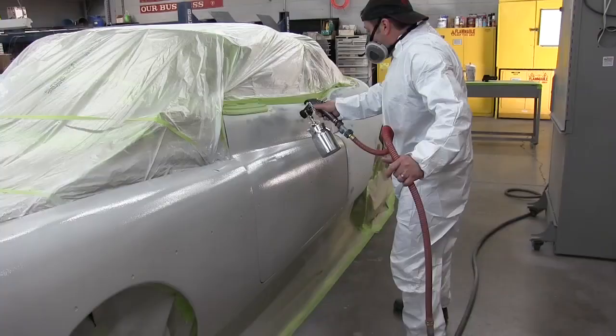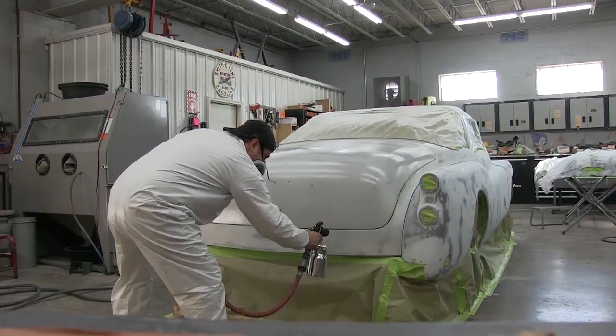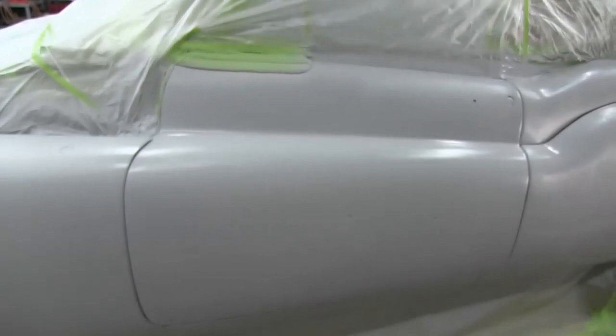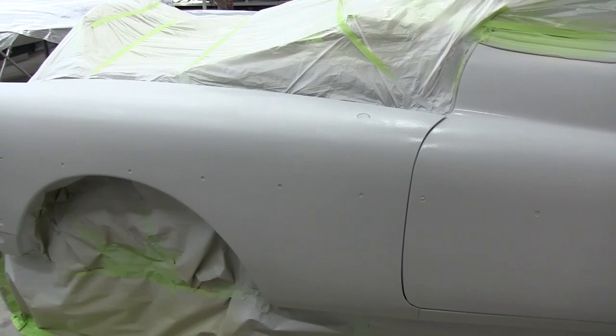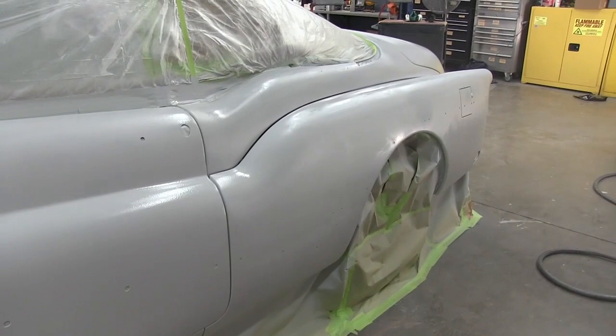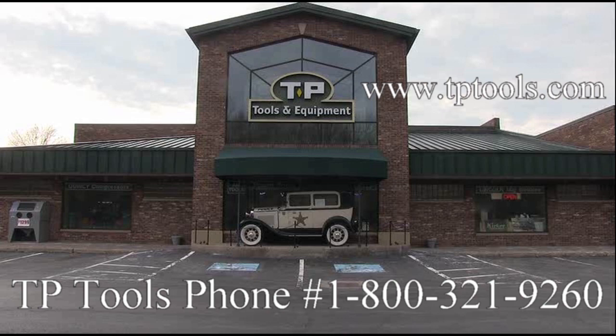Today we learned how to paint our vehicle using a polyester primer. In our third and final part, we'll show you how to finish the job. Our next video, we will use a urethane filling primer, which is used to seal the bodywork and fill in the sandpaper scratches created using the 180 grit sandpaper while block sanding the polyester primer. Urethane primer fills, seals, and also continues to tighten up the surface tension, and it needs to be coated with urethane primer to get the proper adhesion with the final paint. TP Tools — we have the auto body and restoration tools and equipment you'll need from start to finish. Thanks for watching, see you next time.